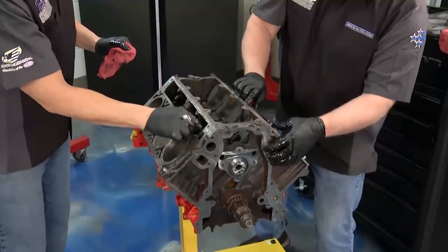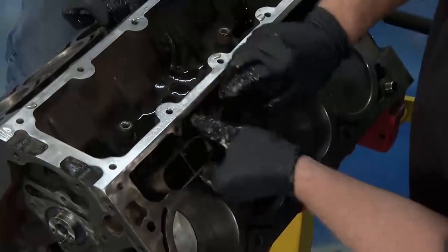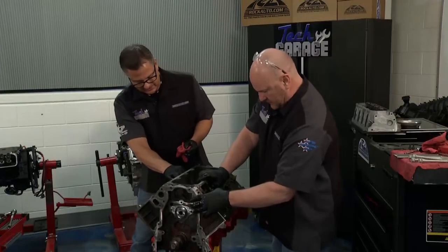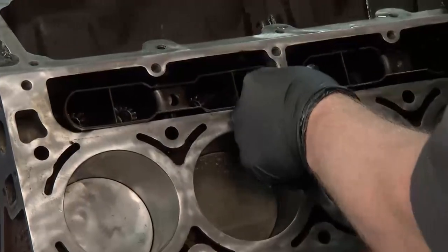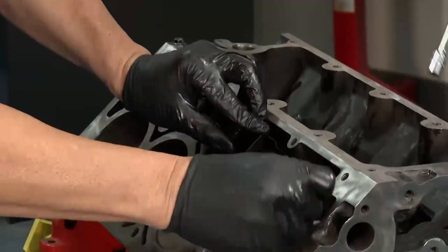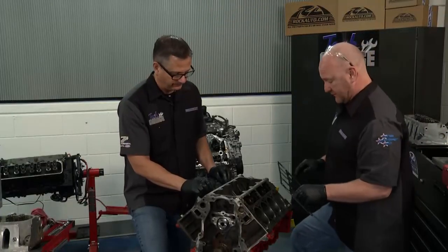You want everything to be precise. We've been doing it all along, and we go back and torque everything and make sure everything's right. Sometimes we have to pull something back out and make a change we know is necessary. We don't want to just put it in and be done with it. Right beats speed all day long, especially when you're this far in. You give yourself permission to do it really right. Make sure the little flats of the lifters are up and seated all the way. Ready to put a head on there.